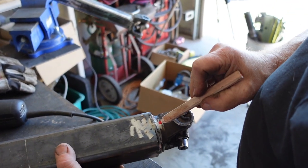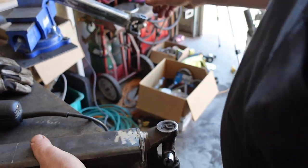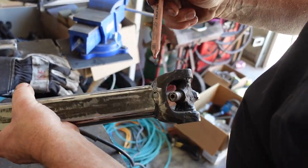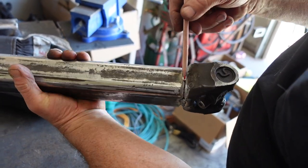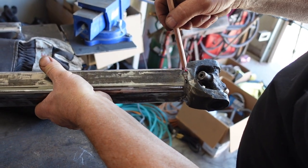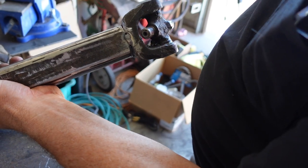So what we're going to do, again, he's going to weld these two more welds up, do the same thing here. We've done the same thing. You got a tack, got these four tacks, I've opened them up. He's going to burn one in the root, not filling it up, just right in the root. Once all four of those are done, then we'll open this one up, clean all the slag off, and then he can burn one over the top of all of those.